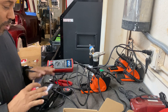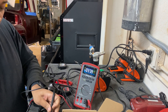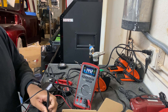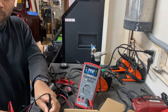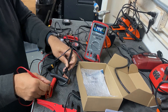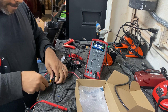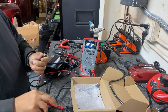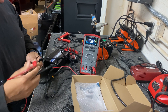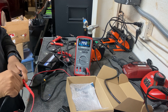So we got it all wired up and plugged in. You want to verify that it works — negative on the negative lead, positive on the positive lead — and we get 14.4 volts. Now I'm going to remove the alligator clips. We got 14.4; now removing the alligator clips and switching to the tender side — we get 14.2 volts. So we know it's working.